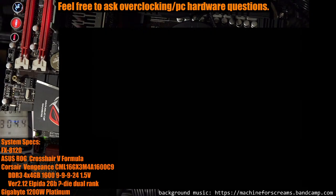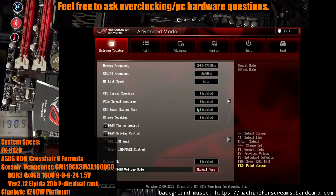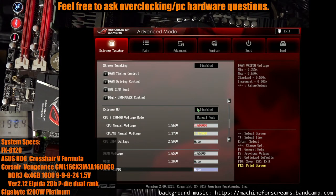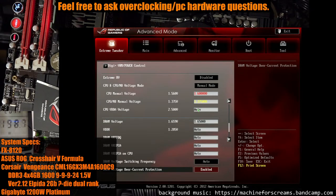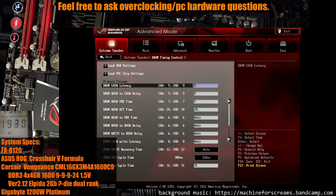Okay, well... No, I think I literally did it on some random 1600 rated Hynix stick. Oh no, that was 2933, I think, or 2800. It's mostly that you just need Haswell. You need a good Haswell CPU with a good motherboard, and then 2933 gets pretty easy, assuming you have Hynix MFR. BFR can kinda do it. Well, 2933 is actually very doable on BFR, but 3000 is much more challenging.